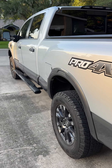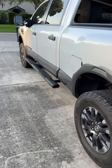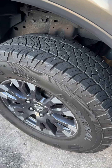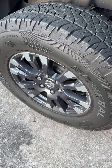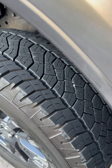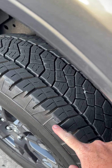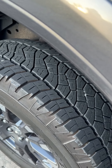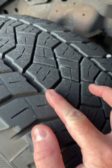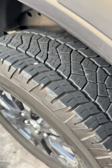Time for another video — this one is on tires. I got the level kit in the last video, so the tires aren't cutting it anymore. These are the factory Pro Force tires, 275/65/18. They call this an all-terrain; I would not call it an all-terrain. The alternating lugs stick out on the side, but other than that it's really not an all-terrain — see how close these grooves are, there's no real traction voids like a typical all-terrain.